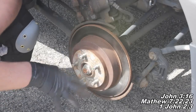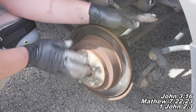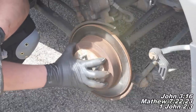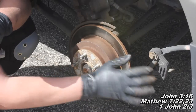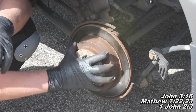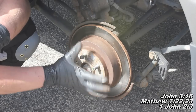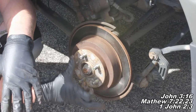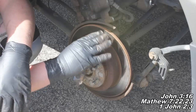One thing I failed to mention: we've got a dual braking system here — drums and disc brakes. The drum inside is only going to work when you're applying your e-brake. The disc brakes are what engage when you're actually pressing the brake pedal to stop while driving. So the drum brakes here are only for the parking brake, meaning they probably last the life of the car. Mainly you'll be changing these pads and the rotor when it drops below that discard thickness number.